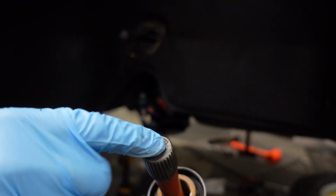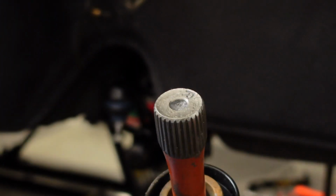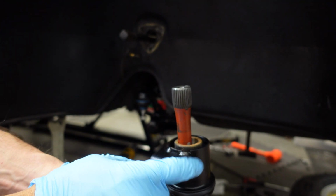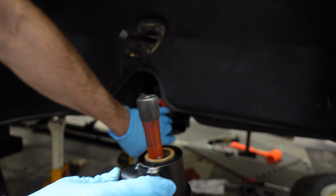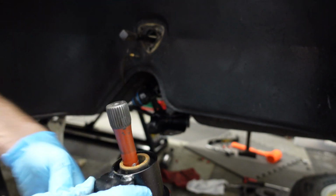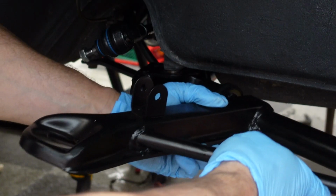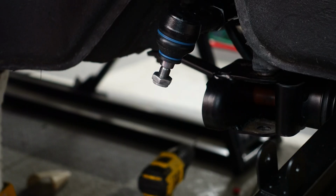So the torsion bar is hit home there, and you can see that they're keyed to a side. See the R? Guess what that means. And now I'm going to put this carrier into this area here, and that slides in, but it's a tight fit, so it takes a little finesse. So this is now a matter of banging from the front and from the side.